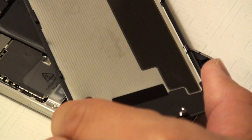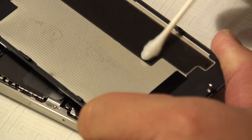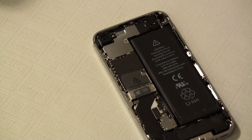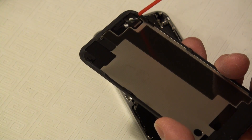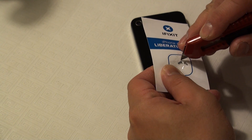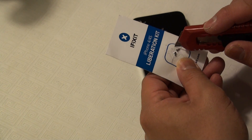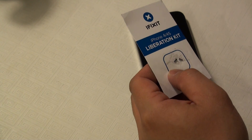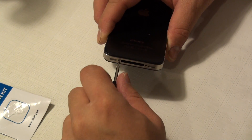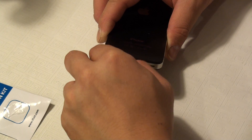Also take your alcohol swab and clean the general area where that spring contacts. Before placing the rear cover back onto the iPhone, take your compressed air and give the camera a quick squirt to make sure there's no dust on the lens, then do the same for the back cover. Reinstall the two bottom screws in your iPhone. Since I bought this repair kit with the iFixit liberation kit, we no longer need pentalobe screws and instead use plain Phillips screws. Using our double-zero Phillips screwdriver bit, very carefully reinstall the screws.